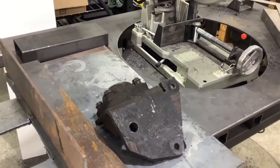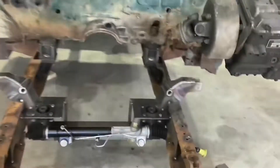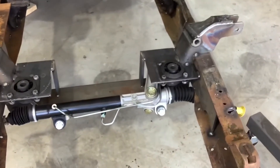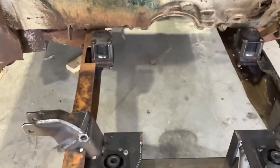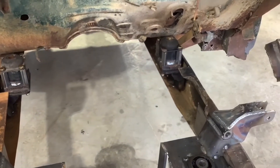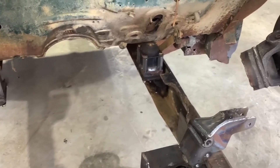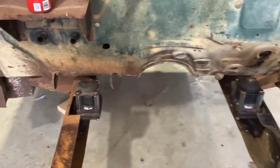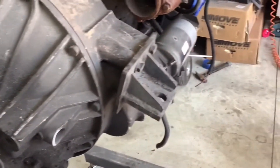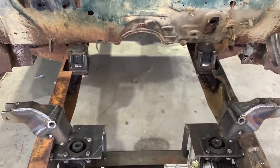A lot more than I figured getting into this, but it's fun — we're tinkering away. I spent all day on these motor mounts and I'm not proud of that, but that's what we worked on today. So we have the front mounts tacked in, we've got the rack and pinion in, the rear mounts back there we modified — we had to lift them and notch the frame. We're going to strap that. We're very close to that cab, so we're going to try to put it in there and see how close we are and if it fits, we'll finish welding everything in place.